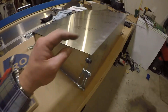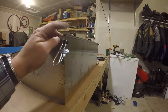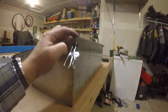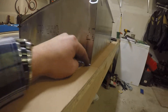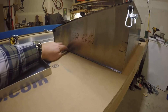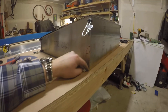But this turned out very, very good I think. There's a little bit more of a gap up here than I'd like, but that happened because when I cut this to length it bent back, so I've actually got to hand-seam that down just a little bit and that'll draw the gap tighter. But overall I'm quite pleased. I'm hoping the guys that are going to weld this don't have any issues with my work. The skins can draw down tight to the ribs and everything seems to be good.